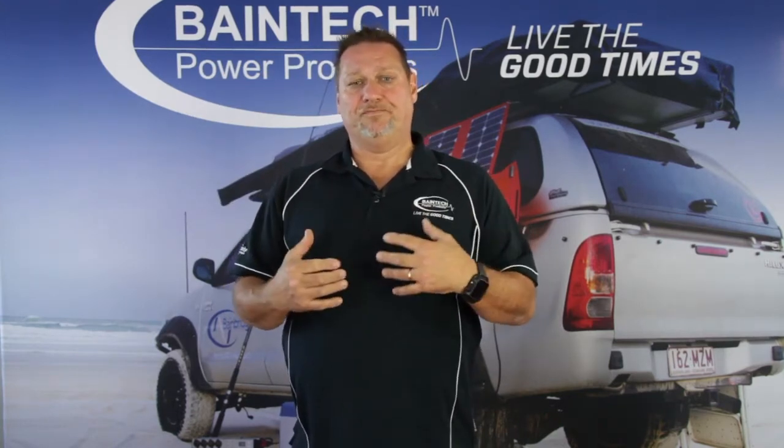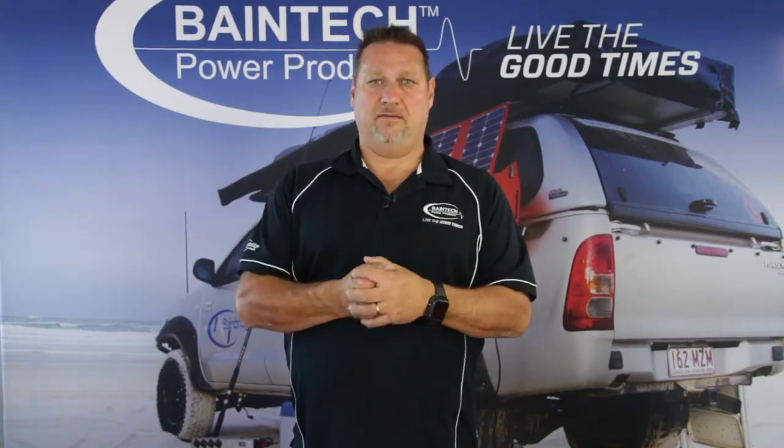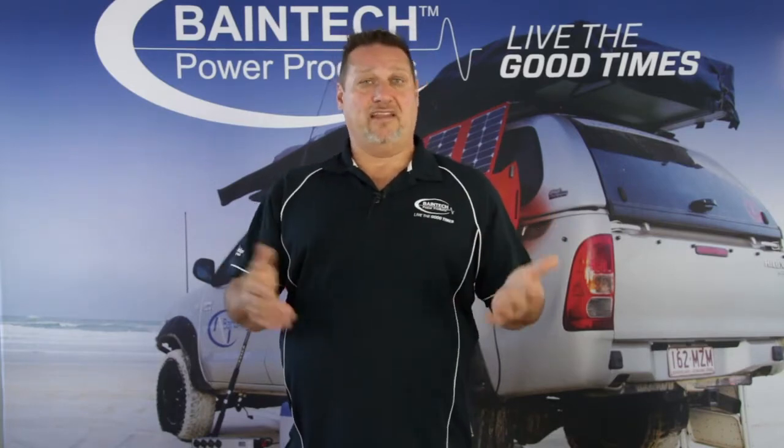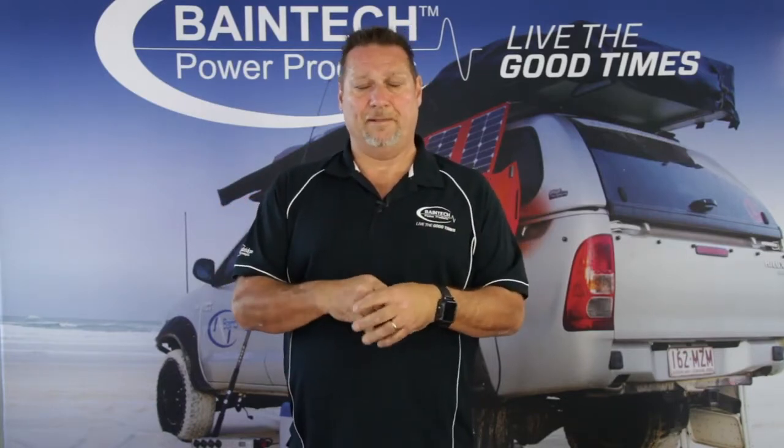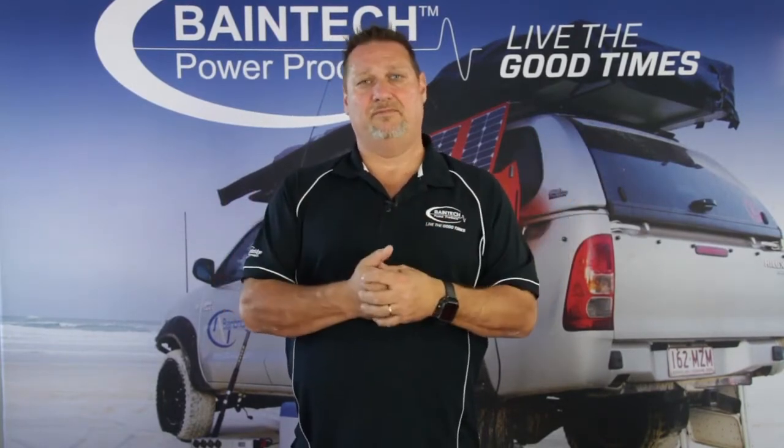So the problem with that is, let's say, for example, you've got an 80 amp alternator in your car. You might have certain loads during the day. If it's raining, you have windscreen wipers on, or you might have a heater and a demister on, and they all put a little bit of load on your alternator, which is covering the current those devices need to run. So let's say you've got 20 amps coming through to run the auxiliary stuff in your car. You've got 60 amps of residual power there.